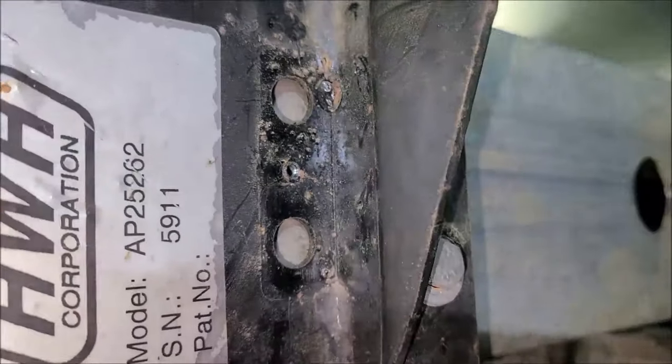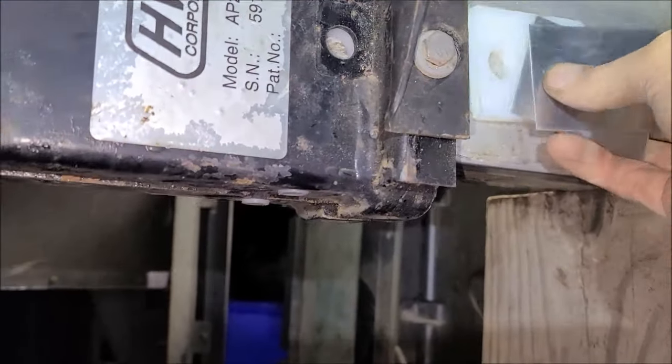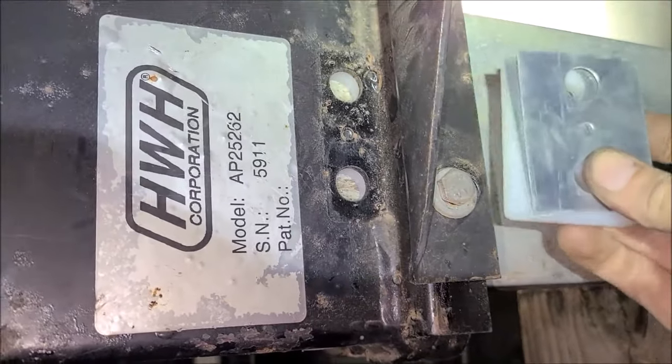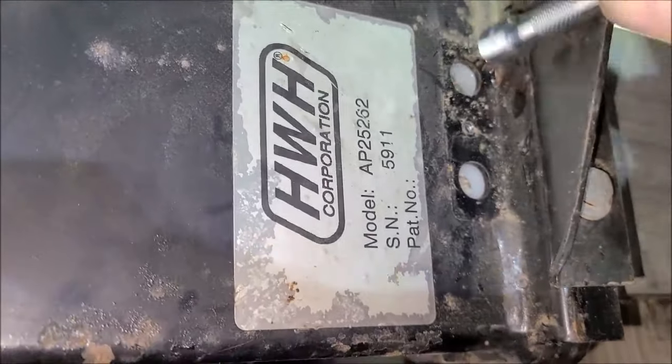All right, let's get our shims. Okay, it took a few minutes, but I got it lined up. Show you how I did it. Take these, remember these only go in one way. You see how it's rounded? The flat edge goes with the shims, because the rounded edge you want to slide against here. Because we got it positioned just right, it created just a little bit of friction so I could get it started, and I slowly tapped it in with a blank one of these. Once I got really close, then I took an extension here and got these holes lined up.